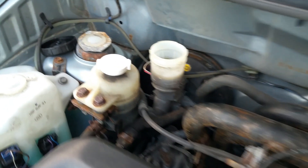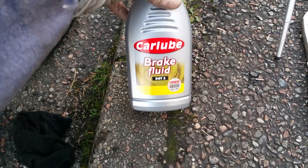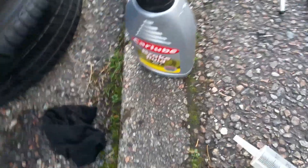Remember to keep a check on your brake fluid — you need the cap off the brake fluid reservoir. It's low at the moment because I've been in the process of bleeding. As it gets low, top it up with the recommended fluid for your car — in this case DOT 3 — yours might be DOT 4, 5, or 5.1, but make sure you check.